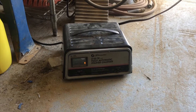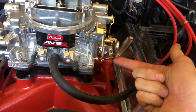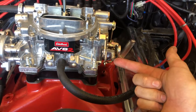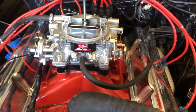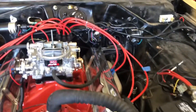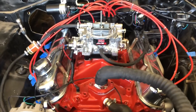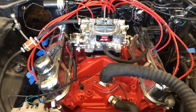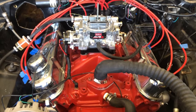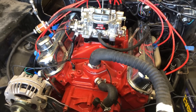At this point we're just going to sit here and wait on this battery to get fully charged, and then I think it's going to be time to fire it off. This time hopefully it's going to run a lot better because I got the idle set screw right here — it was backed all the way out, so I went ahead and cranked it in quite a bit. Once it fires off I'll back it down and then take the timing light to it and make sure we just get it dialed in as fast as possible so it can sit and break in. We're going to keep our fingers crossed that everything just works really well once we get this battery charged.